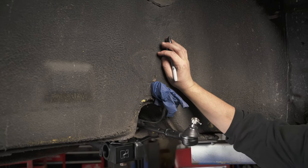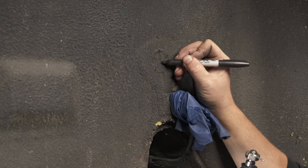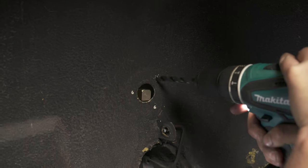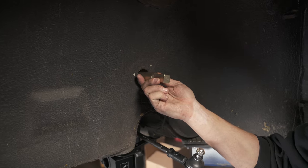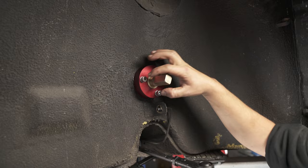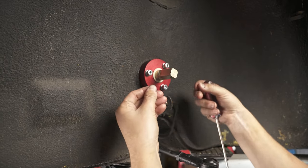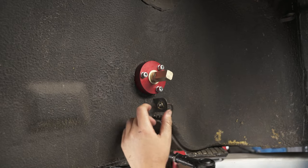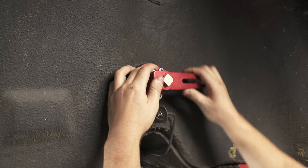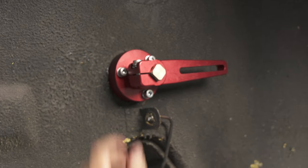Now we've got to install the through-body turret sway bar. You can still see the factory imprint here — I like to use something circular to find the approximate center of the hole, then take the hole saw, line up the center, and drill through. Next, mark the three holes and drill those. I slid the turret sway bar through the body with the inner mounting plate going inside the car and the blocks on the outside. I put bearing grease on the back side of the part and the inside of the car so when they sandwich together it makes a nice seal, keeping water and dust out. Next, put the locking collar to hold its location — make sure you can access the screw on top. The link goes on after; it should move nice and smoothly with no hang-ups. If there are hang-ups, loosen both sides and adjust. Now we're good to tighten everything up.